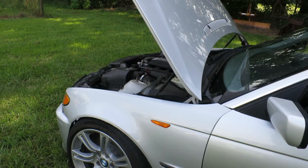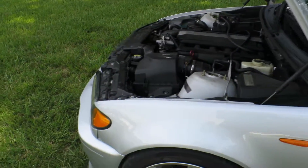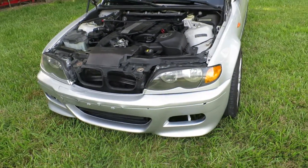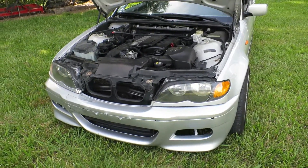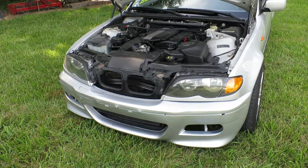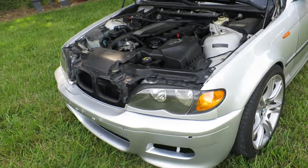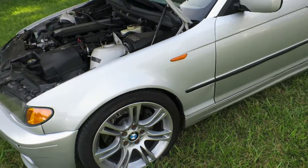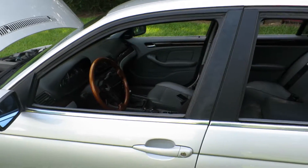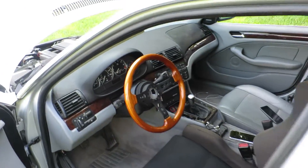That's pretty much it for the suspension. As far as steering goes, no real angle mods — I have steering rack spacers, about 4mm per side. You can get them in 1mm washer sizes from McMaster-Carr, they come in a pack of 25, it's like $8 — totally worth it. The car gets just enough angle to maneuver around the course and throw a little bit of extra angle if I need to correct on the inside.